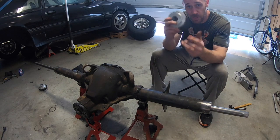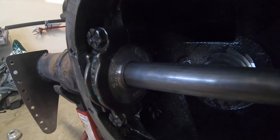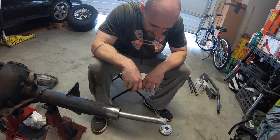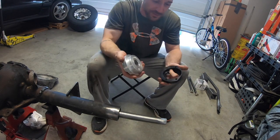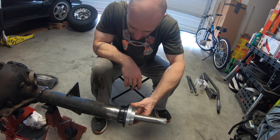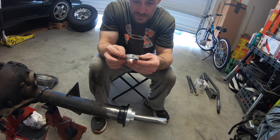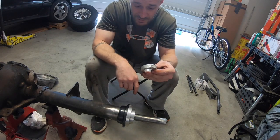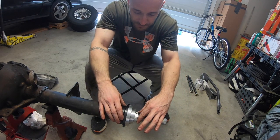I'll show you the inside — the inner bearings go on these main caps, which I've got torqued down to about 80 foot-pounds, and the bar goes right through the center. Fits pretty nicely. For the outer bearing: you've got the outer bearing piece, then the actual nine-inch end itself — it locks on and slides smooth, and there's a keeper that prevents it from moving so you can weld it on. There's a little allen head in the center you tighten down to position it.